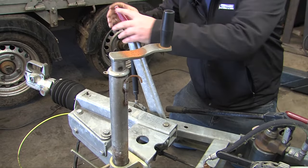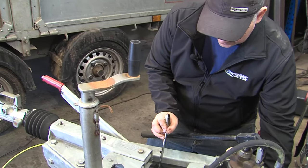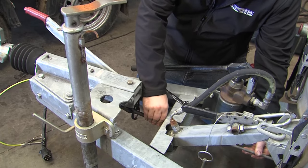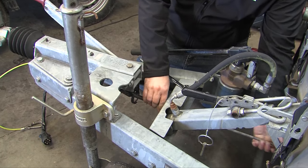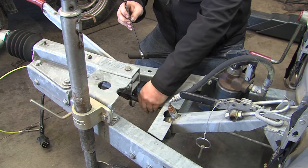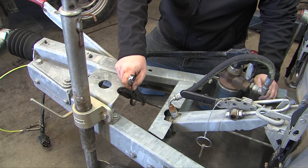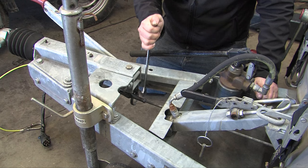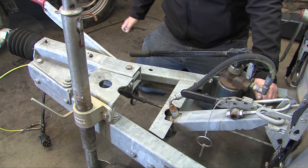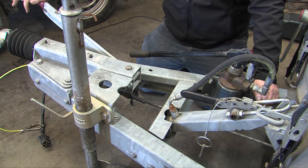That is just two clicks. Just get it that tiny bit tighter, then get the locking nut and tighten it up. This stops the brake rod loosening within the back of the coupling and makes sure that your brakes operate correctly.